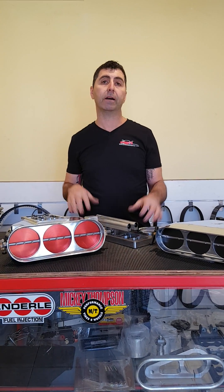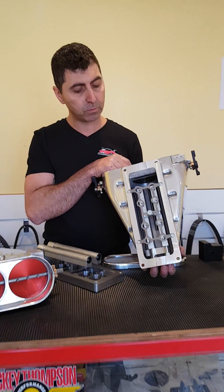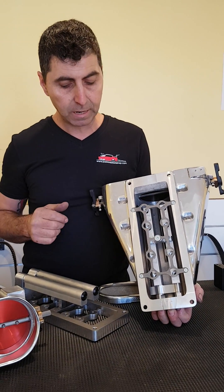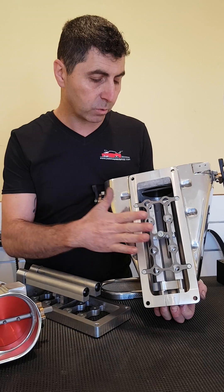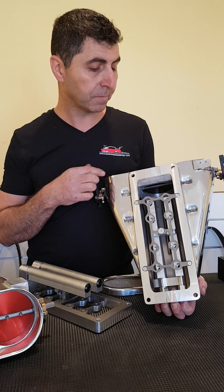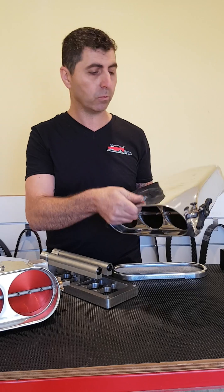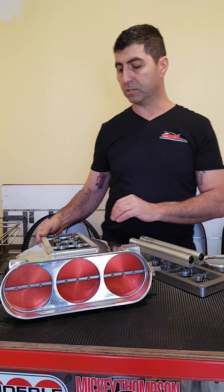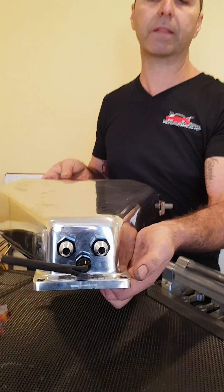Now if you're looking to get your hat down as low as possible, we do the JB007 kit, which is what this one has, and this kit fits straight into the hat. We machine them here and fit them in, and what it does is it eliminates the 25mm plate in the JB001 style, getting it down that 25mm lower. We can also machine the base of the hat 15mm off it, so they become really low profile. The bug catcher is only 115mm tall and on the birds they're 130mm tall. As you can see, this one's already got the injectors and the wiring harnesses all connected into it, coming out through the back.